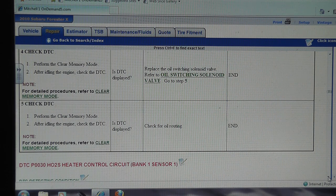This is what we deal with in this field, and frankly I'm fed up with it. These engineers need to figure out we have a bit more brains than they think. Tell us how the circuit works — tell us if it's pull-up or pull-down, power or ground-side switched, pulse-width-modulated or not, and what a scope signal should look like on this wire. That would be a huge help. We cannot do proper troubleshooting on a flow chart like this.